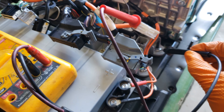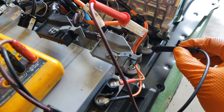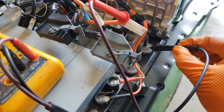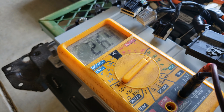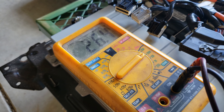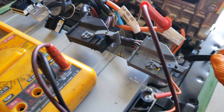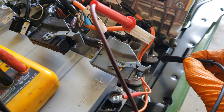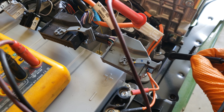This is dangerous, obviously, being careful. But it's just DC power — it's somewhat harmless if you're not touching both legs. We've got some voltage leakage. This was causing the red triangle and 'Stop Safely Now' warning. It was also throwing code P0AA6 for battery isolation fault.